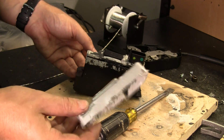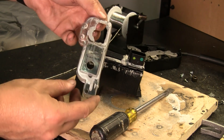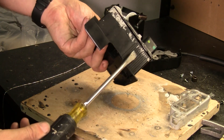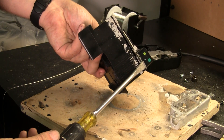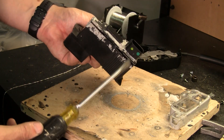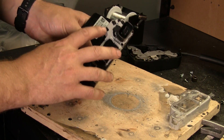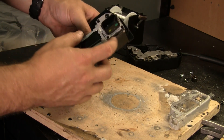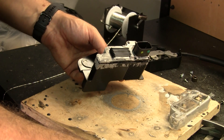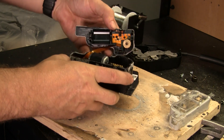In a shocking turn of events, I did manage to get this piece off without damaging it. It's a little bit marred here and there, but it could be reused — you could possibly do a little bit better job than I did. I just used more leverage with a bigger screwdriver, went from this side, went under it, and pulled up very slowly letting it release all the way down. It eventually came off. We've got four screws that are kind of buried under here, and that's all we have to this. It is the same Torx as before, which is a T10. So now we can take this piece apart and see what we're working with.